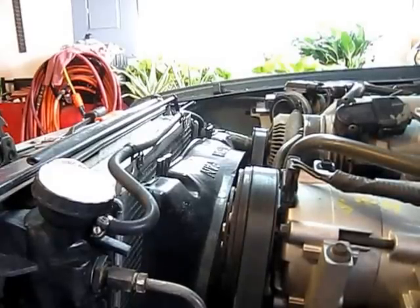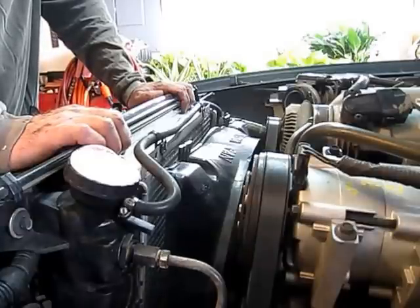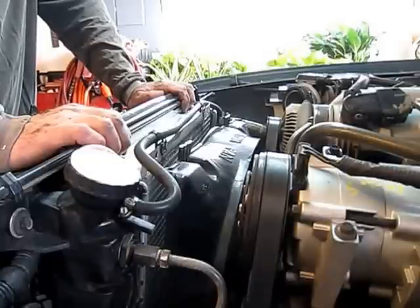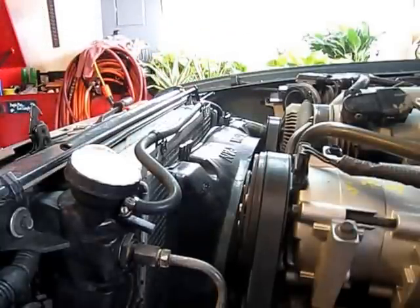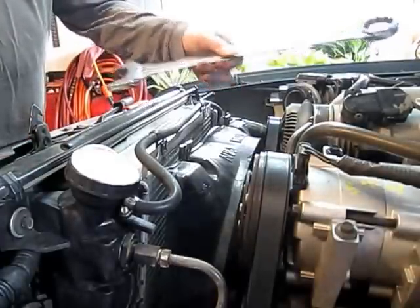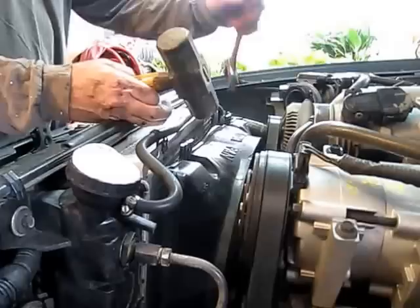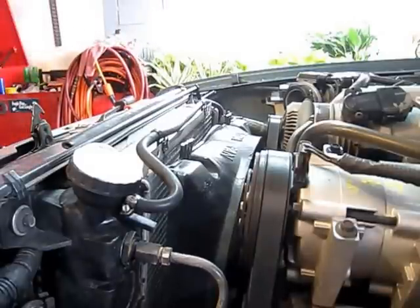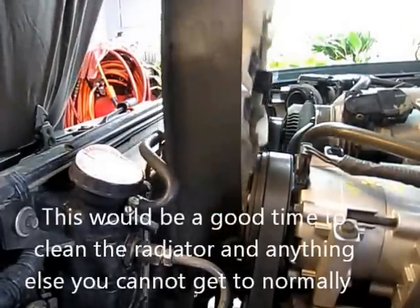I've got it ready to come out. And an FYI — I said earlier the fan clutch was counter-clockwise, but this model fooled me: it was righty-tighty, lefty-loosey. I've had them both ways, so please check your manuals. When you put the wrench down in there, I happen to have the big wrench — you can get these things at any one of those shops, very inexpensive. Big hammer, smack the end of the wrench — it's kind of like doing an impact wrench — and it's going to knock it off. Once it breaks loose it'll come right off easy. I've got the fan shroud loose; we're going to bring it all out at one time. There she comes right on out.